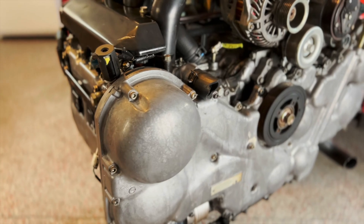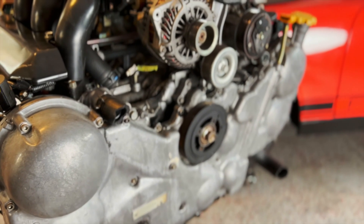The factory exhaust systems on larger sedans and wagons are very restrictive, so with custom headers and a very short exhaust out the back of the 914, there should be a nice bump in horsepower. I'll also need to run a custom ECU — looks like I'm going to go with the top-of-the-heap Haltech Elite. With that ECU and good tuning, it seems like a real possibility to get 280, maybe even 300 horsepower out of this engine, which would be absolutely fantastic.